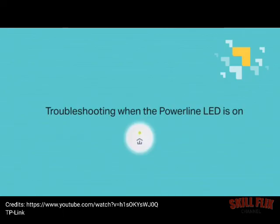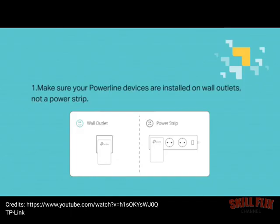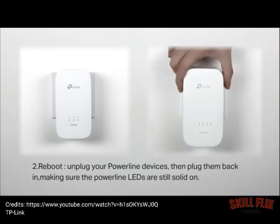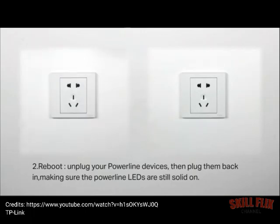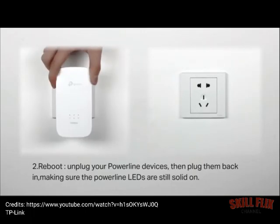So, troubleshooting when the Powerline LED is on. First, make sure your Powerline devices are installed on wall outlets and not a power strip. And we can start rebooting. You can do this by unplugging the Powerline devices, then plug them back in, making sure the Powerline LEDs are still solid on.